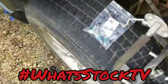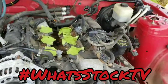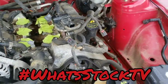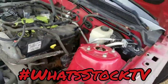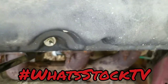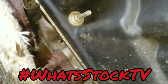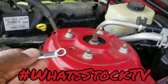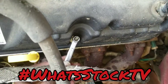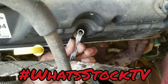All of that's done. Now I'm about to get these valve covers off — it should just be six 8mm bolts, these short ones, and then a couple of these longer ones. I don't have a deep socket so I just got this wrench, but I tested it and I can reach all of them with the wrench. It's not the best but it works.